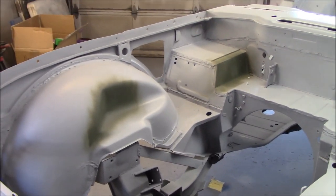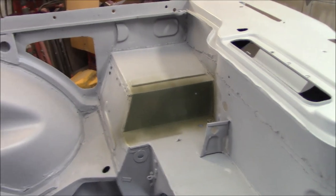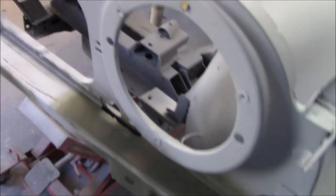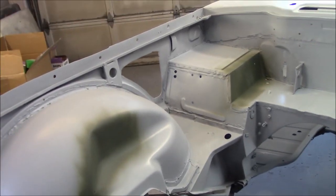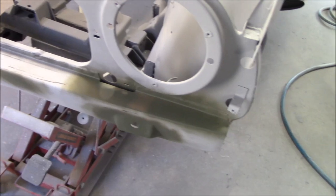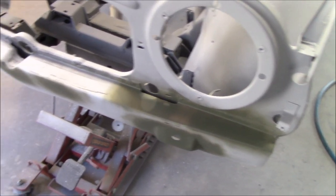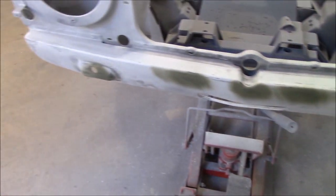Just coming up to around 1:30 in the afternoon - we've got the areas repaired and etch primed where required. It's looking better. We also did some areas on the nose of the car. Next step is to get the maroon scotch brite out to scuff up the repaired areas, then over-prime those and get them ready for the next step - block sanding with 400 grit and finishing with 600 wet. Not a lot of priming to do which is good because it's awfully hot.